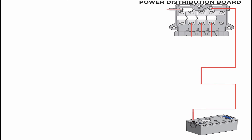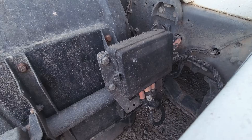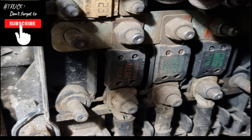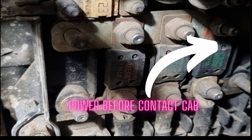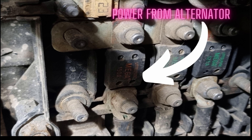After the batteries, the main power supply cable enters the power distribution box. This can be found on the near side wing of an LF, and on the near side of the engine block under the PCI ECU. The main power supply cable is connected to a metal collector strip, which provides 6 fuse positions for the various electrical systems. These include the sense connection for the alternator, power supply before contact to the bulkhead, and power supply from B plus at the alternator.